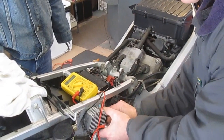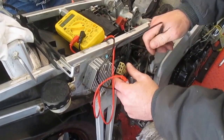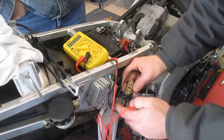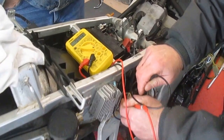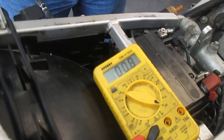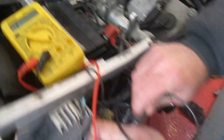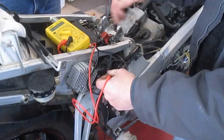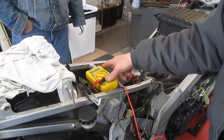Then you can take the regulator rectifier wire out and do readings between the contacts. The three pins up top are the three yellow phases coming directly from the stator. This is ground and that's hot. So from here you check the ohm reading between each of these pins — it should fall below 0.1. There it goes, it's within spec. Then you go across all three and they should all read below 0.1. It's telling you that you've got a good circuit going from here all the way to the stator with very low resistance. We saw it go below 0.1, so it's right in range — everything was fine.